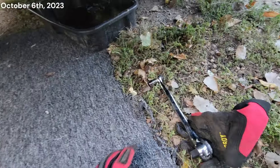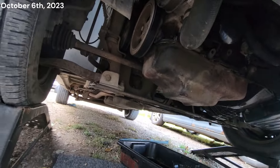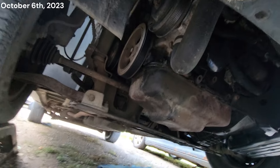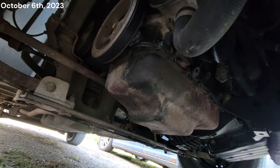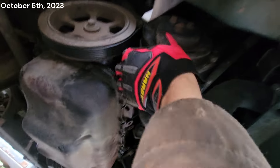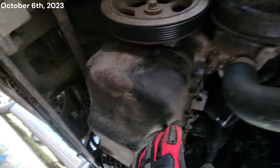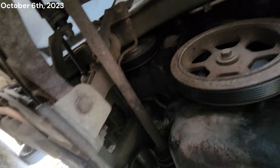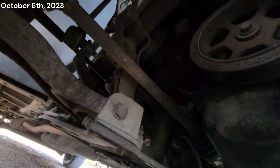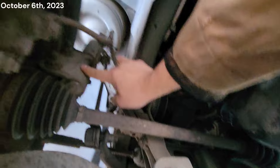I was just under there doing a look around, checking everything looks status quo. I don't have the cover on it — I have one to put on. Water pump's been replaced, about 27,000 miles on it, doesn't wobble. This coolant hose is new, feels good. No major power steering leaks. Idler pulley and new tensioner up there. Sway bar links are all new. Suspension's all new — new strut assemblies and new ball joints. Sway bar bushings are new.